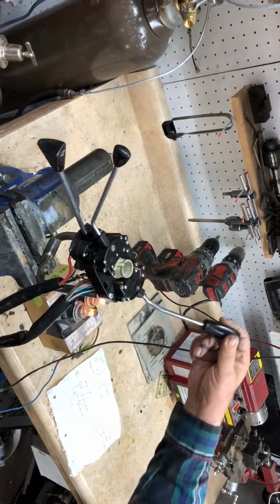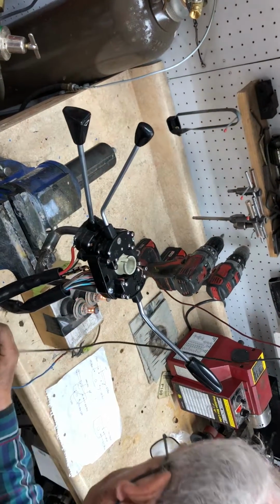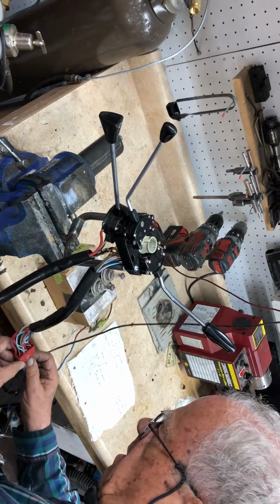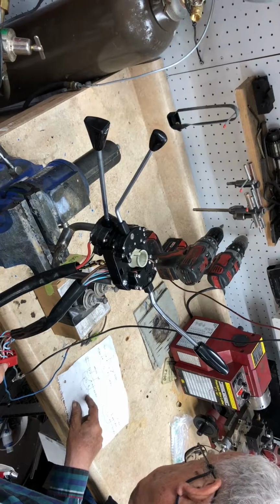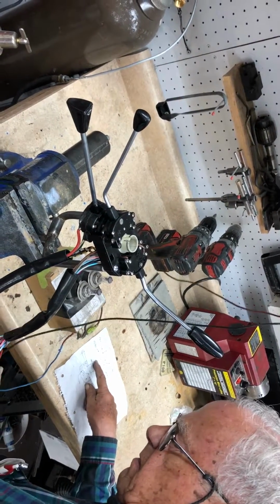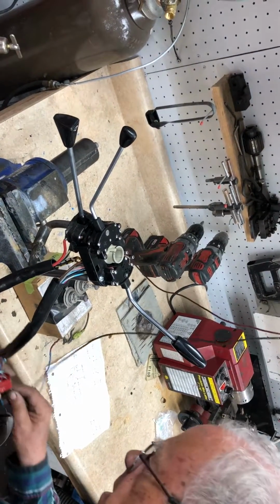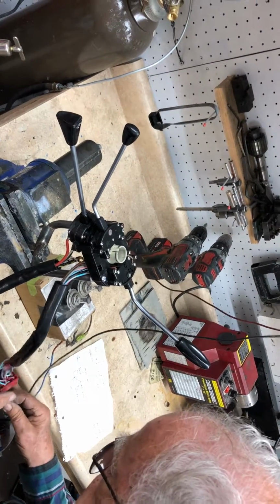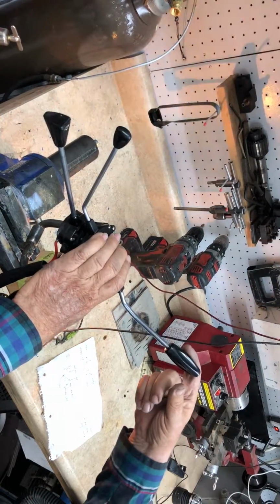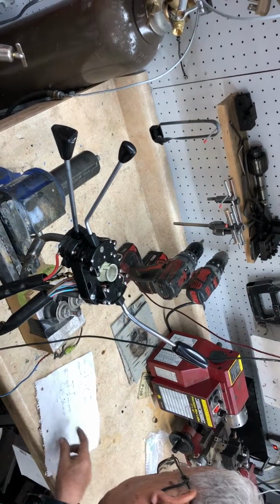Okay, what are we on now? We're on wipers. Okay, so there's wiper high speed. Now he's flipped it back into wiper low speed, so as soon as he plugs in low, it will likely illuminate our load. Gray with black. This one here. And as we discovered, it was already in the mid position, and it did illuminate, so that's our low speed wipers.